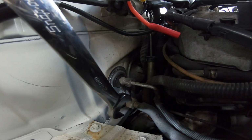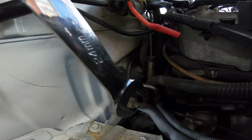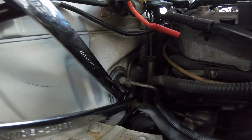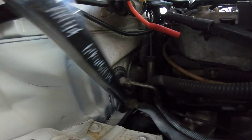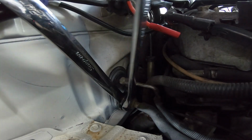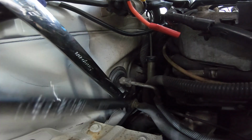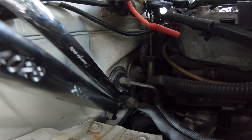All right, to the bottom. Low pressure line is a 24 and a 28. If you don't have those, just use some adjustable wrenches here. Mine's pretty loose, so we know it's leaking out right here. But we don't want to damage it, so we're gonna have a wrench on both ends, and we'll just zip these down. Those two are loose, ready to disconnect from the firewall.